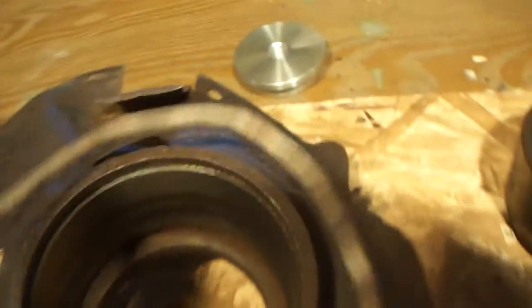So what I decided to do was use one of the wires here and actually use this to heat up the hub so I can get this bearing free. You can see this is the top of where the bearing would sit, and this is the retaining ring. If you guys are doing this job, when you first start, you may not even see this retaining ring — there was so much crap and crud. I went in there, scraped it off, got a cold chisel in there and was able to get rid of the retaining ring.